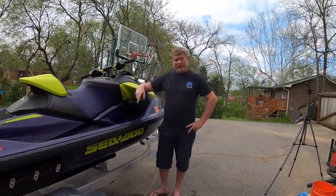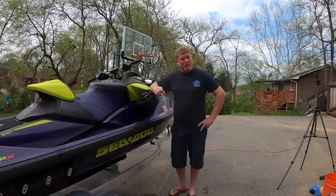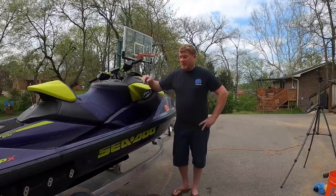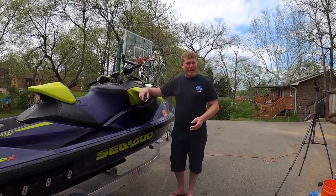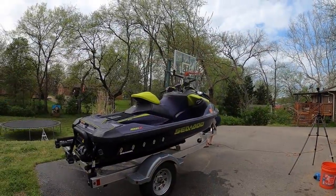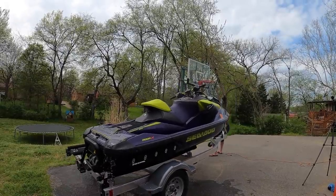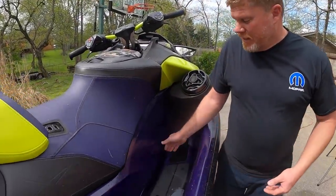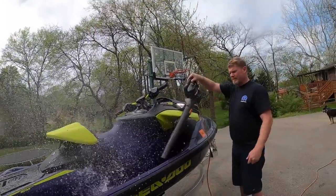For our last experiment, we've refilled our footwells all the way back up to the very top, right where they're about to splash over, just like we found it. We're going to show all you guys who said to go ahead and tilt the trailer and dump the water out just how tough it is to do that. We've got 228 pounds of extra water in a full-size Sea-Doo sitting on a lightweight aluminum trailer. Even though we tilted it at over 30 degrees, we still had quite a bit of water left. So let's get the leaf blower out.